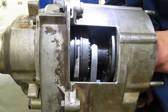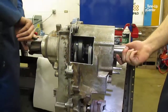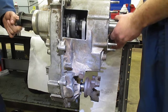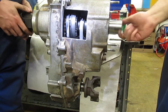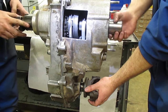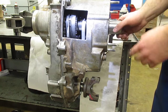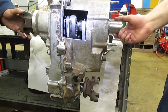Back to high — if we go back to four-high, you can see that only the range moves. That provides a one-to-one ratio: for every one time that the input shaft spins, the output shaft spins one time as well, including the front output shaft. In neutral, it spins freely. In two-high, the ratio between the output shaft and input shaft is the same as in four-wheel drive — a one-to-one ratio — but the front output shaft spins freely. In four-high, all three are connected: the input shaft turns both the front output shaft and the rear output shaft at a one-to-one ratio. And that's our transfer case.